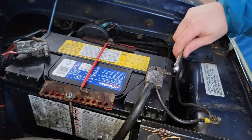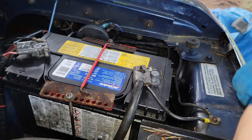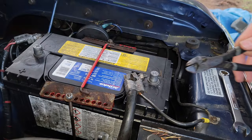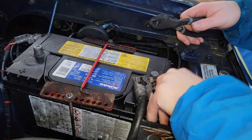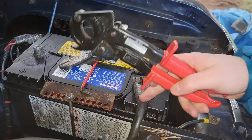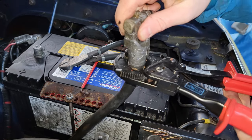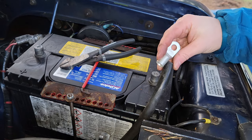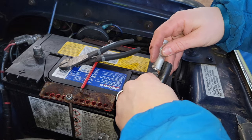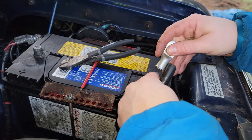I'm going to start with the negative terminal of the battery, then disconnect the positive as well. I'll begin by snipping the chassis ground, then take my large cutters to cut the two-gauge wire, cutting it as close to the terminal as I can. There's the old terminal. Now I'm going to measure how far to strip the wire back — I'll go right where it starts to bend in there, and that's how much wire I'm going to cut back.